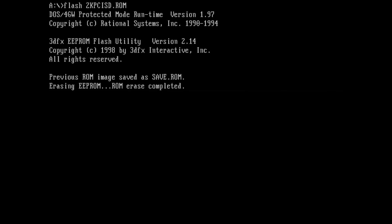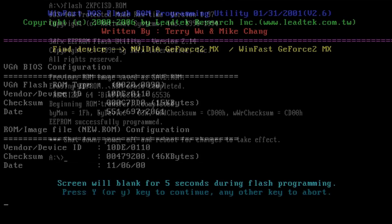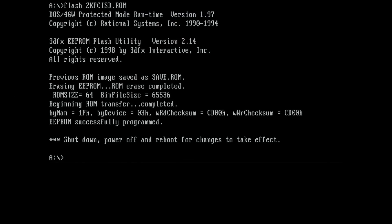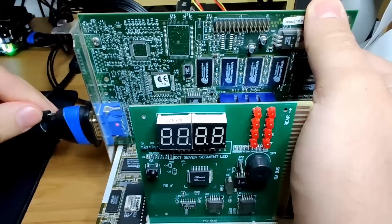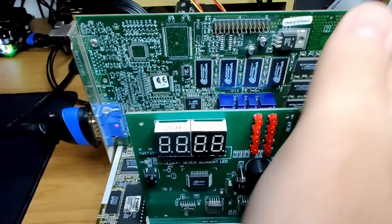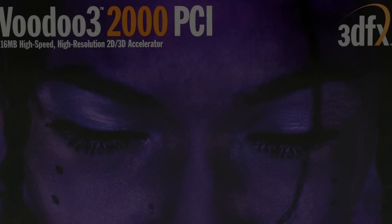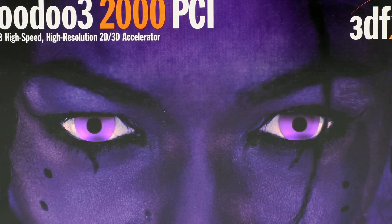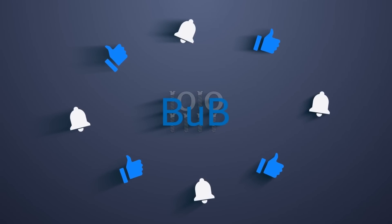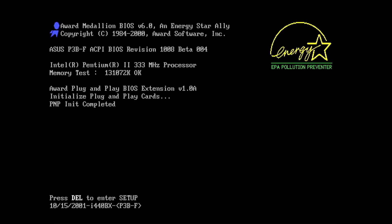This is a very unspectacular flashing process. Once the tool is done, we are informed to turn off the system for the changes to take effect. While the system is off, we can also remove the second video card. Hopefully flashing the BIOS has revived this Voodoo 3. And now we wait in anticipation of a 3dfx splash screen... and yes, the Voodoo card is alive! At least it shows a picture for now.